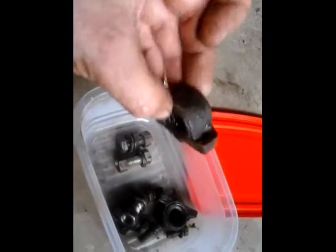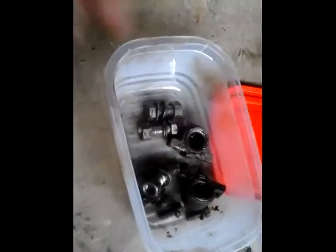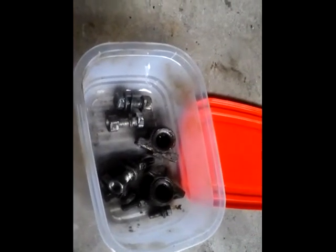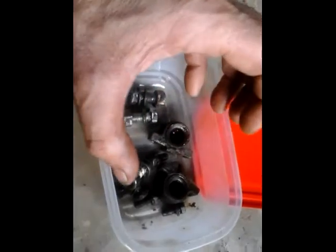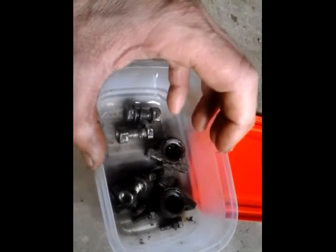Right, okay, I got the prop shaft out, which is relatively simple. We've got two of these on the rear of the shaft connecting to the axle, and so it's just four bolts, and the whole shaft then just pulls straight out of the back of the box. But one thing I will remember to do next time, and that's make sure that the shaft has been turned round so it can be slid out. Otherwise, you've got the two knuckles catching on the bottom of the car, and they won't go anywhere. And obviously, the car's jacked up. I can't rotate it at all. So that was kind of fun.